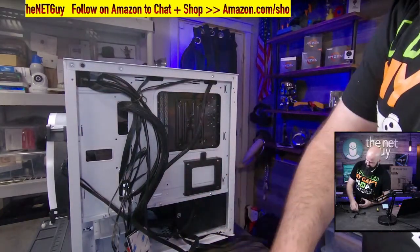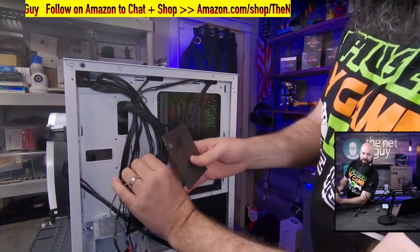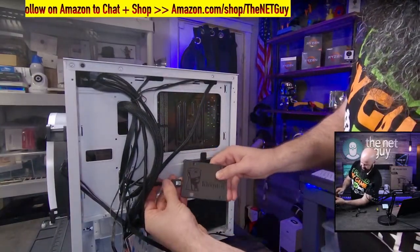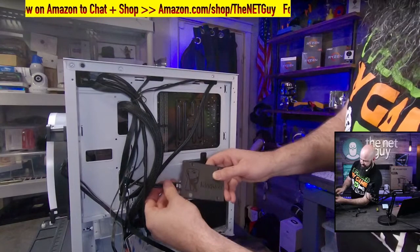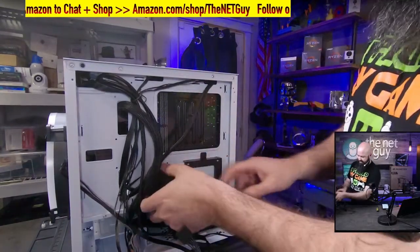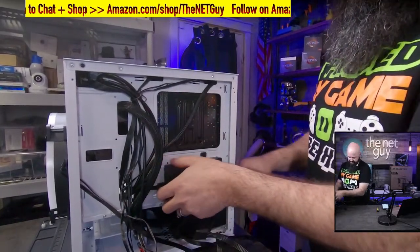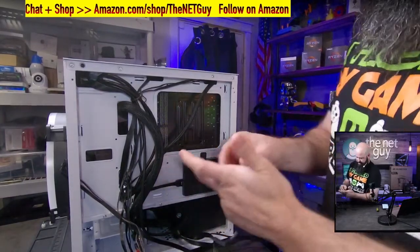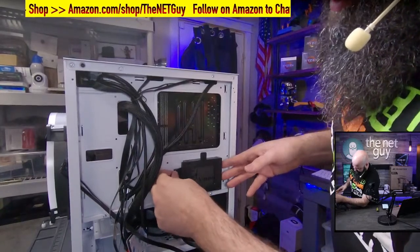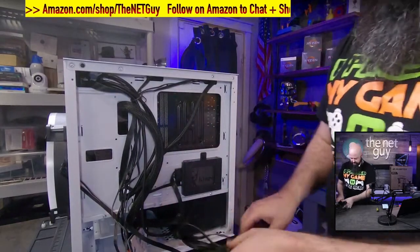I did just plug that SATA connector in the motherboard and I slid it back through. So I wanted to liberate that here and show you how you hook the hard drive up. So the hard drive plugs in just like so, and there's a little L shape so you can't mess it up. That's connected. And now if you're really confident, you can slide it back in here and you can put your screws in if you really want. These things are so light, they're not going to go anywhere. And then I can take this extra connector and I can just plug it onto here. And let's see if I got the angle the right way. I do. Okay, so now our hard drive's in.